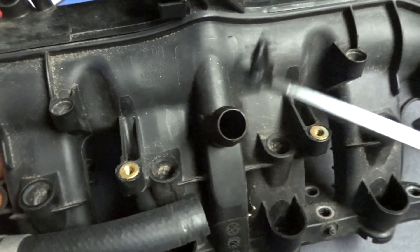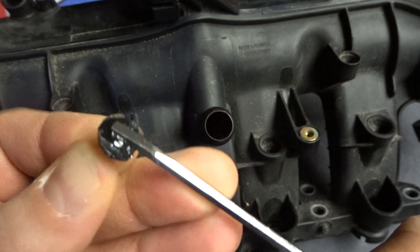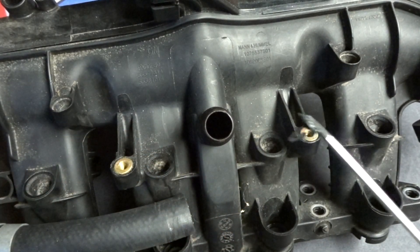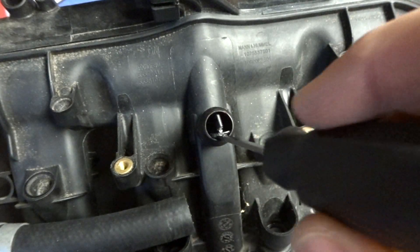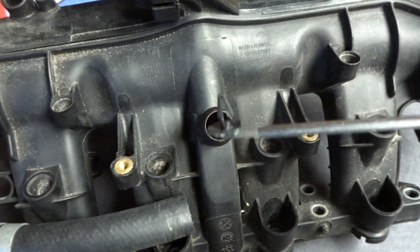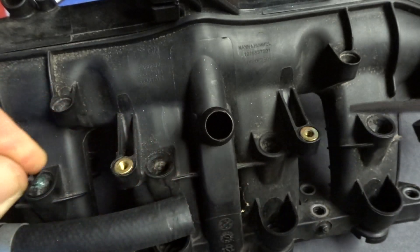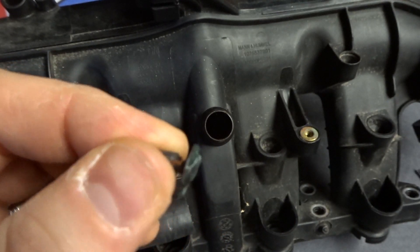You're going to want to be very gentle doing this, because you don't want to actually push the clip in there — you might not be able to get it out and you need the epoxy on there. Once you have the epoxy on there, mix it up and put a big dab around it like I showed in the version 3 fix kit install video. When you have it installed and you push it all the way through into that hole, you'll want to lift up on the screwdriver. Don't pull it back out, just lift up like so and the adhesive will stay stuck to the head of the clip, and that's not going anywhere.